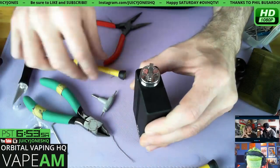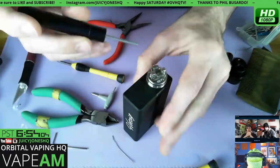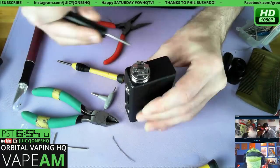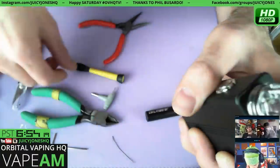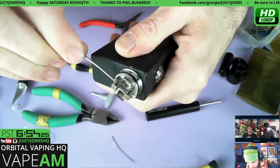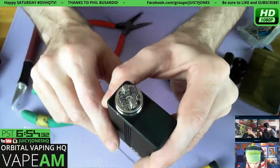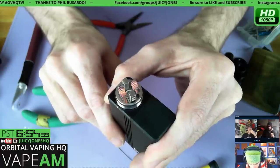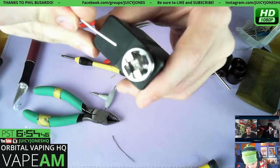Okay. So I've got slightly uneven firing, even with my spaced coil. So that tells me I probably should groom them a little bit. Oh, the grooming. It's not optional, you say? Come on. Tighten that beastie down. You'll be good. Gotta get some connection going. I didn't actually crank them. I never do. I usually just throw them in there and then give them a little lovin'. And they're pretty good, actually. One of them's still a little bit slow, but it's all right. Gonna tighten it up a little more and then brush it.